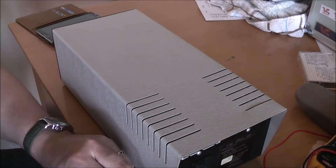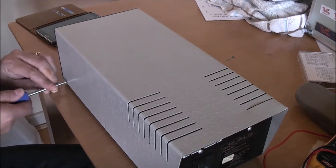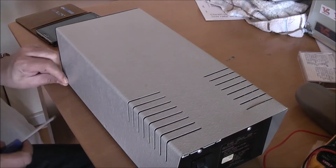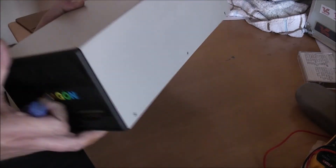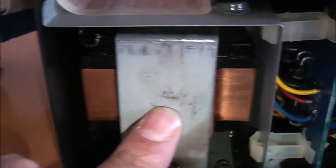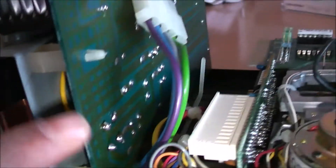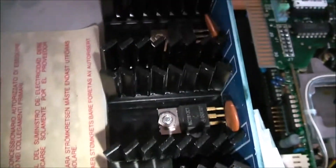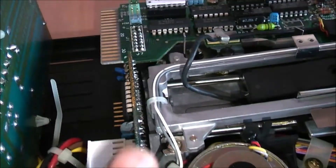I don't know why — possibly a capacitor has failed, or there are actually four voltage regulators in this thing, so possibly one of them has failed, or the transformer itself — there's a huge big transformer in the back of this. Once I get it open I'll give you a closer look at everything. So we're inside the beast here. This is the transformer — it's a huge big bugger — and the voltages come from the transformer and pass into this circuit board which has four voltage regulators across the top, all heat-sinked, and the cables go to the back of the actual floppy itself.